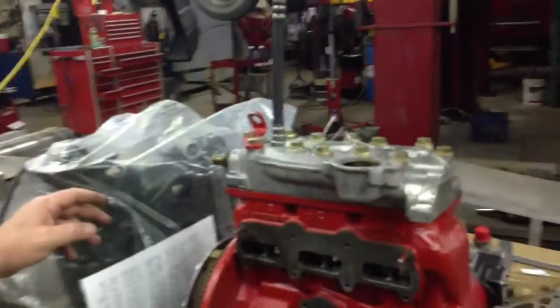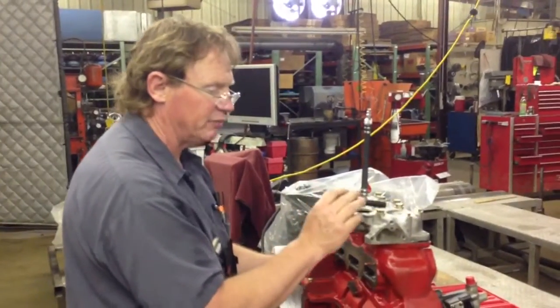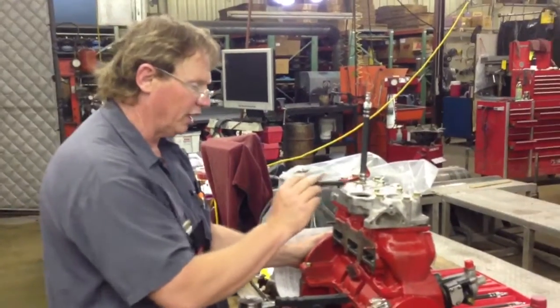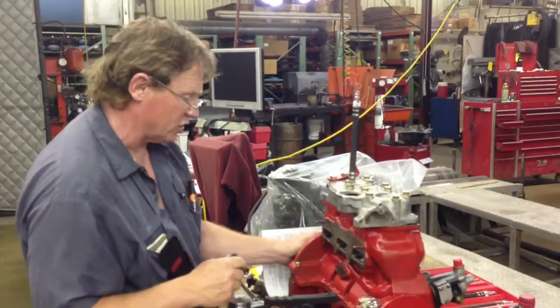I do have a copy of this chart on my website. What we're going to do — as I spun this engine over to do a compression test — it had really low compression: 70 pounds on the rear, 76 in the middle, and pretty decent in the front at 100, which is probably pretty good for a low compression head. Actually, this low compression head is a pretty good combination on the Monte Carlo GT block — less chance of detonation.